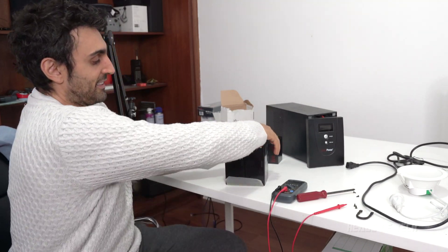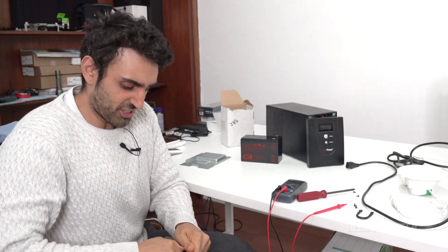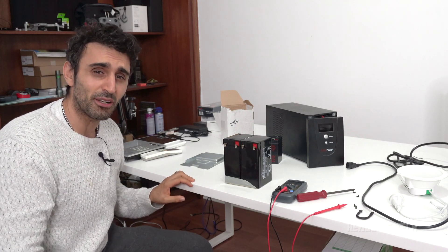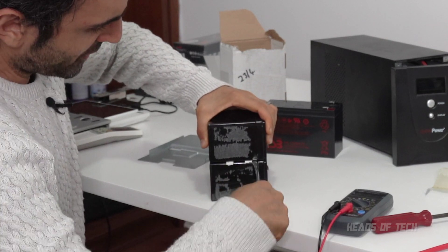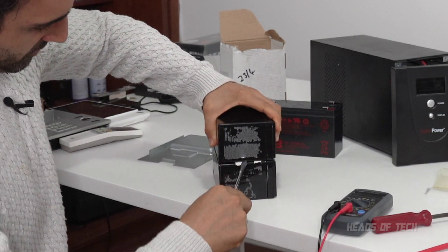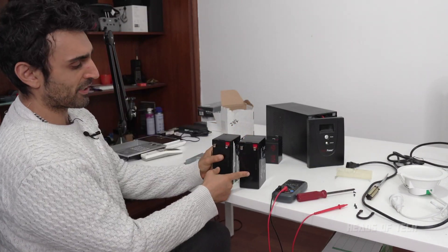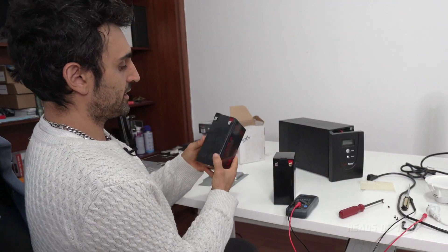Take out the cord that connects the two 12-volt batteries together. You can see in the middle there's a bit of sticky tape, so try to separate them apart without touching the connector points. It is 12 volts so it's low voltage, but no need to touch it. I'm just wedging them apart using a flat head screwdriver — there you go, the two batteries are now separated.